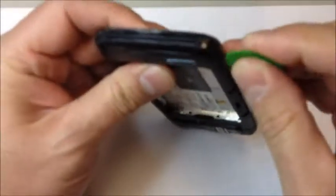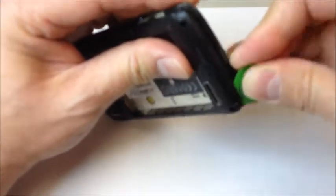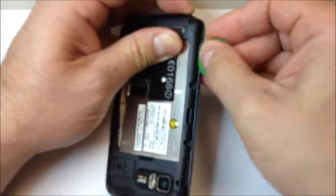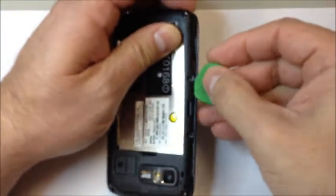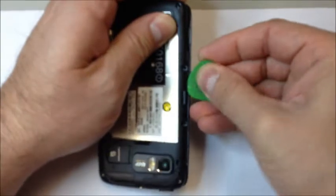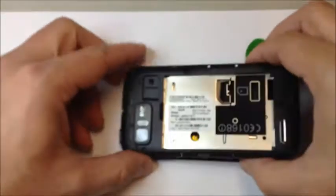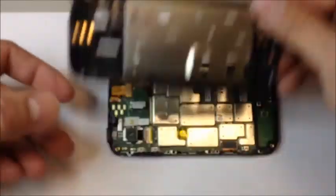Once we have these screws out, start prying just below the HDMI output on the phone — that's a soft spot you can get under pretty easily. Always use a very shallow pry. We don't want to snag any cables, especially near the power button and volume controls. Take the path of least resistance; if you're having trouble in one spot, move to another. Always make sure you haven't missed any screws — if you get stuck, check that first.